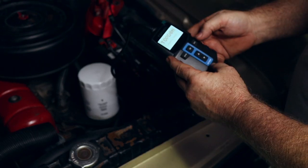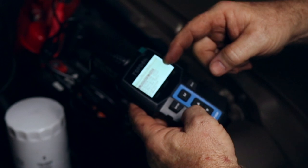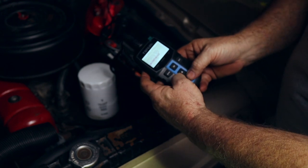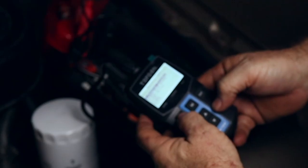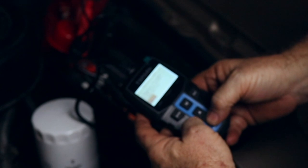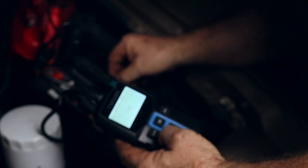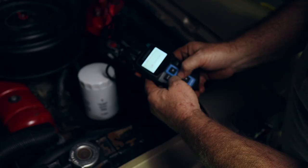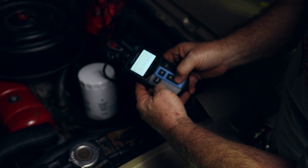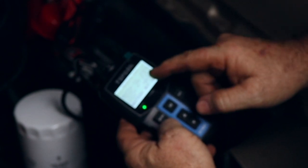The tester shows 12.5 volts on entry. It's got a menu with options: battery, cranking, charging, review data, language adjustment, and tool info. I'm going to do a battery test. You can choose regular flooded, absorbed glass mat, gel cell, or EFB batteries. I'll select regular flooded — a wet cell. Now I need to enter the cold cranking amps for this battery: 700. You can hold the button down to scroll fast, and when you're close you can do individual clicks — it goes five CCA at a time.